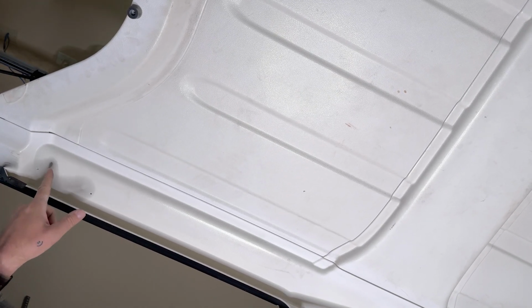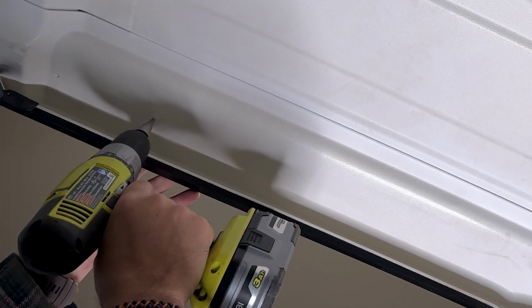So now that we've got the 1/4 inch, we got all the holes in the back drilled, the last thing that we need to do before we can install, we need to take our step down bit, 18 millimeters on this side, 16 millimeters on the inside. We're going to open up this hole for the front bracket. So the bottom holes here get pushed through at 16.